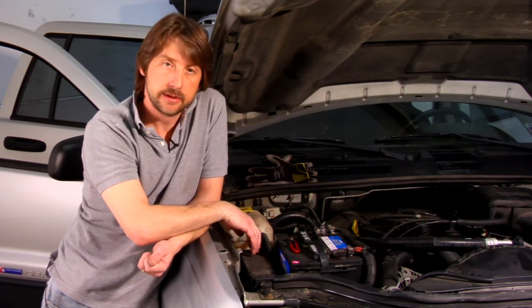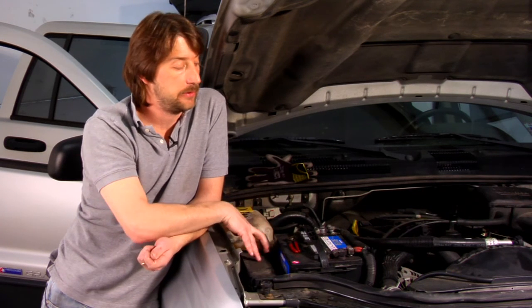If not, check the relays and check the fuse. Other than that, if both those two are okay, then I would look at your fan and make sure that the motor is not burned up or something like that. But that's the easy way I can tell if your radiator fan is turned on or not.